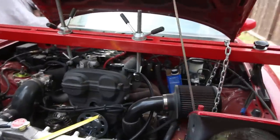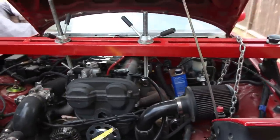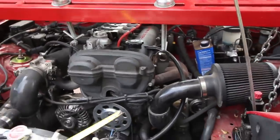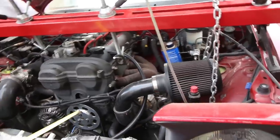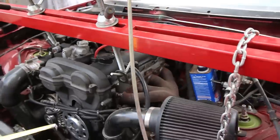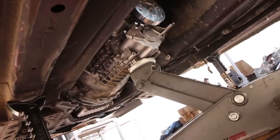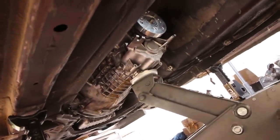Struggling. I highly recommend that you either put a sling on the front of your engine to tilt it back, or use a floor jack on the crank nose carefully to tilt the motor back. It's gonna make the transmission install a lot easier. I'm still struggling with it, but it's lining up a lot closer now. So close for the first bolt in. BMW life! Oh yeah, and one other thing I forget to suggest sometimes. Help another person. Another person would make it a lot easier, but I chose to try this by myself.